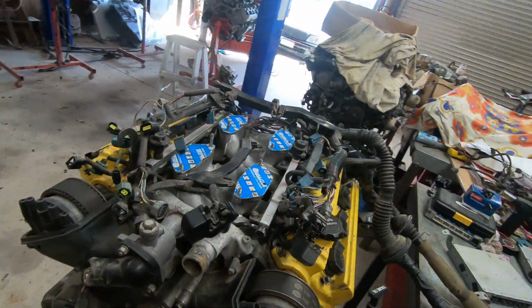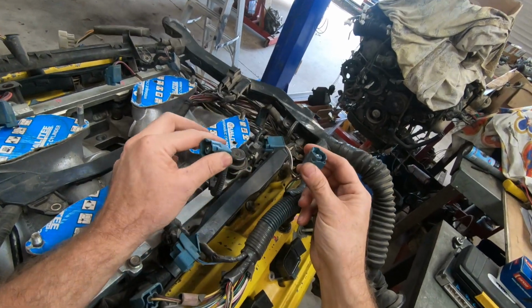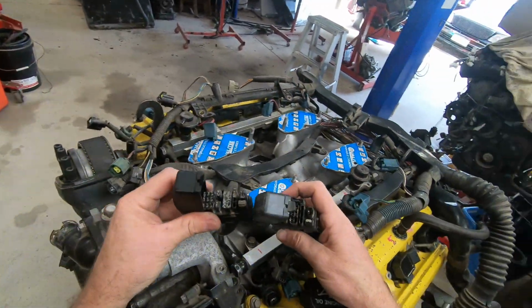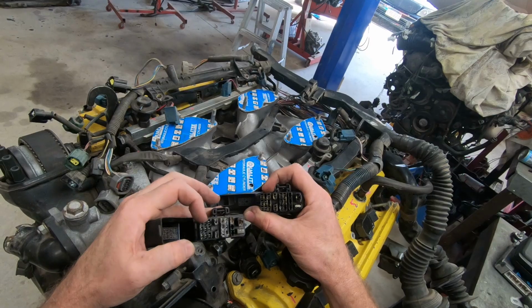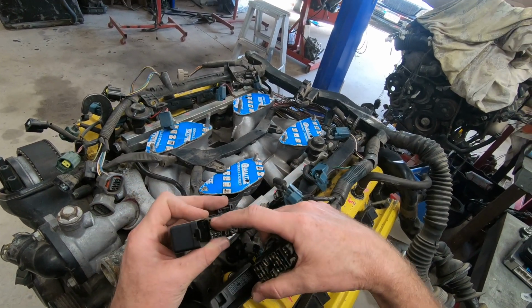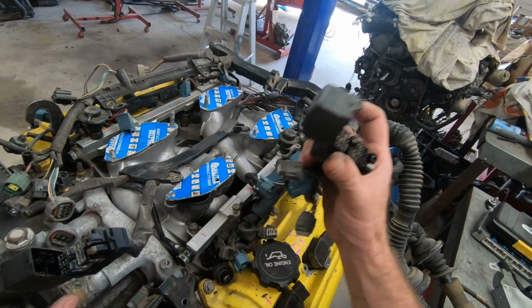Let's have a comparison. So let's look at the injector plugs. They are both the same. They're going to fit. However, there may be a difference in injector sizing, so you need to check that. The diagnostic boxes, interesting enough, they have different pins available in each of these. I think this one you'd actually get communication if it was wired correctly in a conversion, and in a factory car that one would. Whereas this one won't gain communication with a scan tool. It's missing a couple of critical pins.